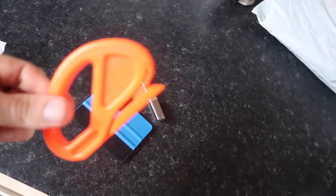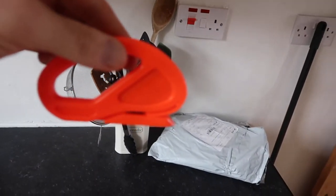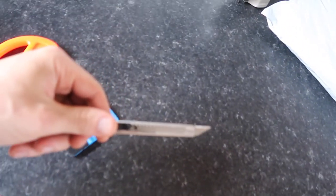She held the bottom and I pushed the vinyl up from above. Then we used a window squeegee to push out the middle section. For the edges we used a window tinting kit — a credit card-style squeegee tool. It also has a blade to help cut the vinyl, but we preferred scissors and a sharp Stanley knife. We found a spray bottle, put soapy water in it, and used the credit card to squeegee all along the edges and down the sides.